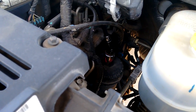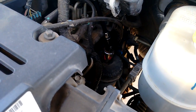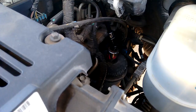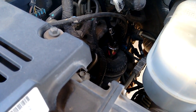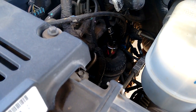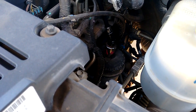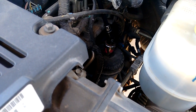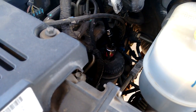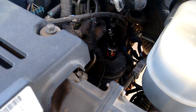I imagine this engine is used in a lot of places. But the nitwit at the factory — I don't know if it's the Dodge plant or the Cummins plant — put this damn filter cap on with an impact, I guess, and overly tightened it. It's got a rubber O-ring on there. Hardly more than finger tight is all that's necessary on these things. But no, they jack them on there.